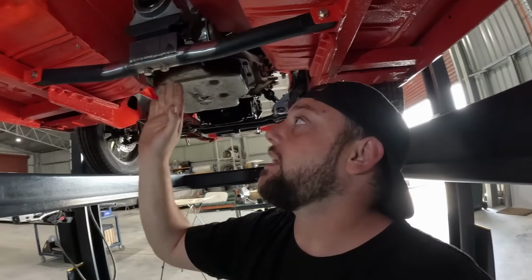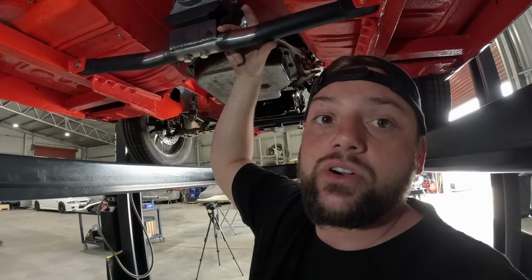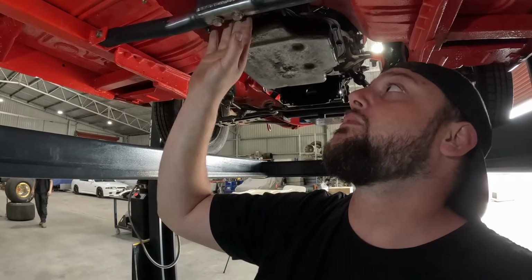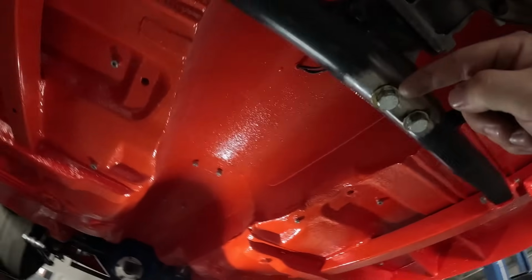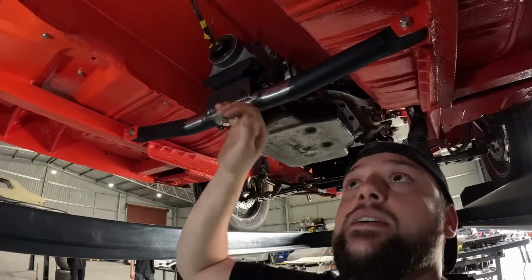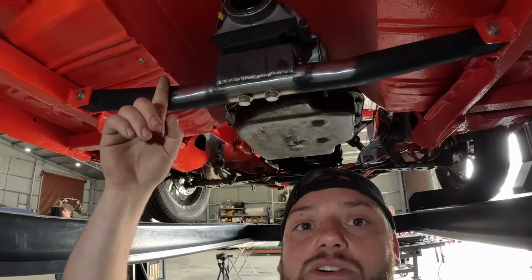So what we've done is just made it step up. You've got two caps that we're going to put on the side here, but we're not done with it, so we've just put it in for now so we can continue on with the rest. And we've got two crush tubes that we've welded in place here that go through the middle here up into place. So factory turbo 400 mount. And then we haven't painted it because you'll see we've cleaned up areas either side.